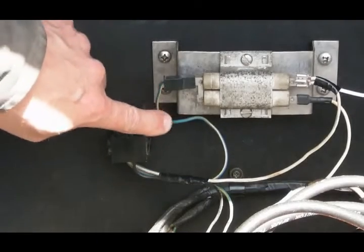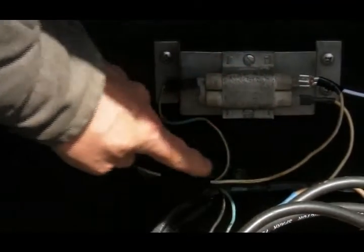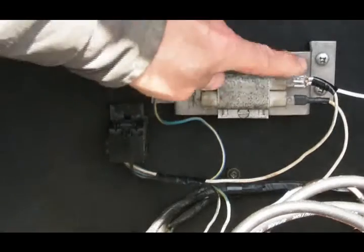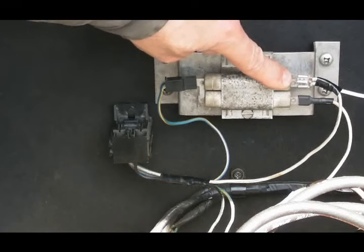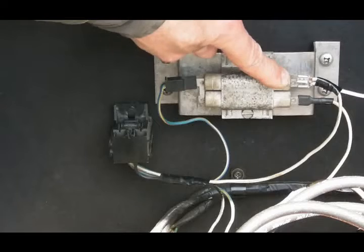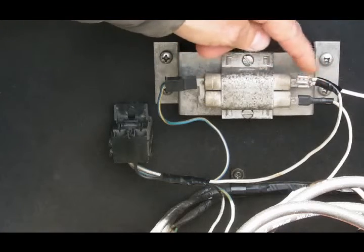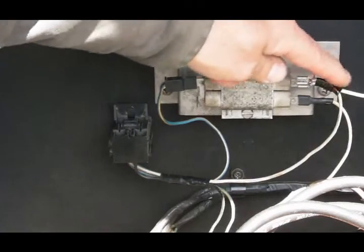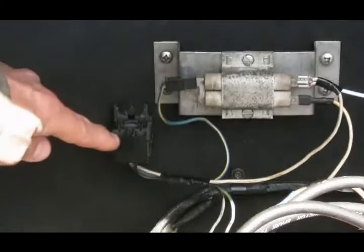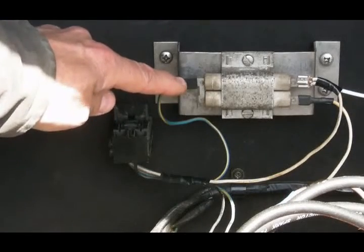What you need is a way to turn the voltage on this wire on and off, and that's what this relay does — it's an on/off switch for that bypass. This wire does not run to the starter motor; it runs to this relay socket. This white wire is what supplies it — it goes from the white wire. Ordinarily there is a fitting that lets you connect two quick connects to one terminal. So these two white terminals would be connected together on that intermediate fitting, and this white wire runs down to the relay socket. When the relay is triggered, it goes back up to the blue-with-yellow wire to the halfway point — that's how voltage gets there.